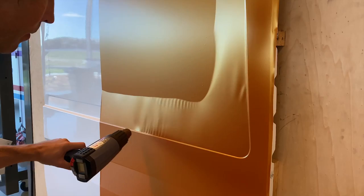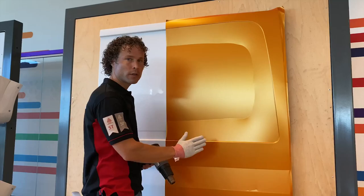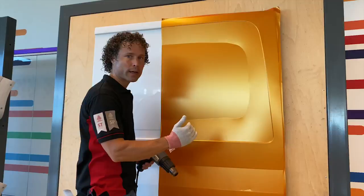You can actually see it as well. If you warm up the film, wrinkles appear. If you then warm it up a little bit further the wrinkles disappear again. At that moment the film reaches this temperature. When the film has cooled down you can feel that there is less tension in the material. Of course if you are going to apply the film into the corrugations you will have to warm it up again to the right temperature. I always first take away the tension on all areas of the entire panel and then start to work it into deeper parts. So work step by step.